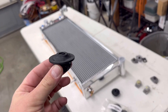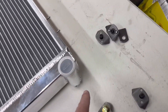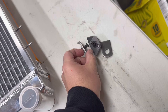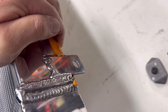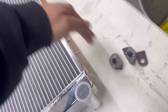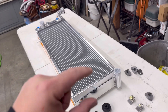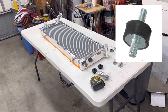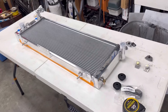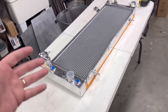This radiator is also going to go through a lot of thermal cycles — getting cold, then hot, then cold, then hot. Being made out of aluminum, it's going to expand and contract quite a bit, so we want some soft mounting. On the top side I plan on using trick tabs with quarter-inch screws, and since those tabs are slotted, that'll help with thermal expansion. The lines running to the radiator will be soft so they can flex and move independently from the chassis.